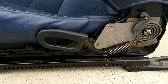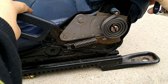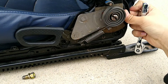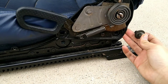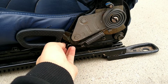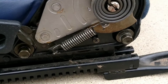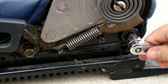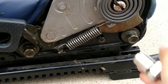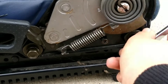After that, go to the other side and pick up two gray 14mm bolts and tighten them on the two big holes on the bottom, because that's where they fit. Tighten until it feels snug. For this, you wouldn't need thread locker — it's a seat, not engine parts where pressure could easily cause things to fall off. I'd use thread locker on engines, but not here.